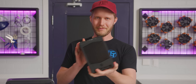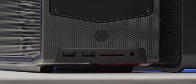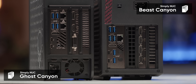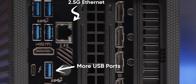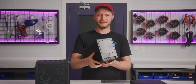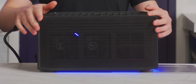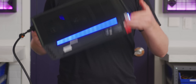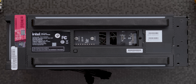Just look at it. There's so much room for activities. The front IO is mostly unchanged from the Ghost Canyon — it just moved down a bit — while the rear IO gets a couple more USB ports and upgraded to two and a half gigabit ethernet. The Thunderbolt ports have been upgraded to 4.0 from 3, and the WiFi has gone up from six to six E. And it's got underglow. A young Brian O'Connor would shed a tear. There's also a super easy to access M.2 slot, bringing the total in the system up to four.